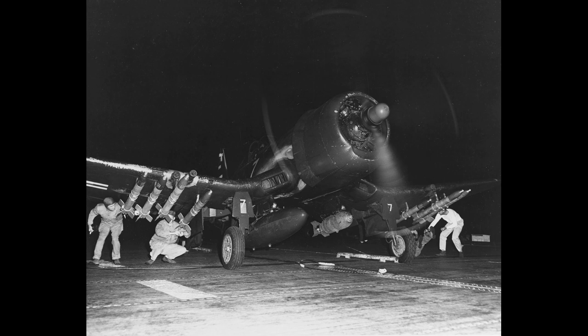They could also have solved it with a fatter fuselage combined with longer gear, but that would have sacrificed the gear strength and slowed the airplane down. The bent wing created enough propeller clearance without sacrificing gear strength or speed, and that's the point of the design. Of course, the extra complexity of the wing design offsets the gains a bit, but overall it results in a net gain, which is why they did it.